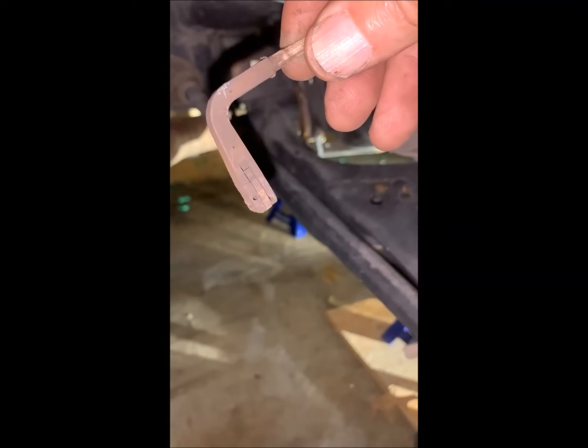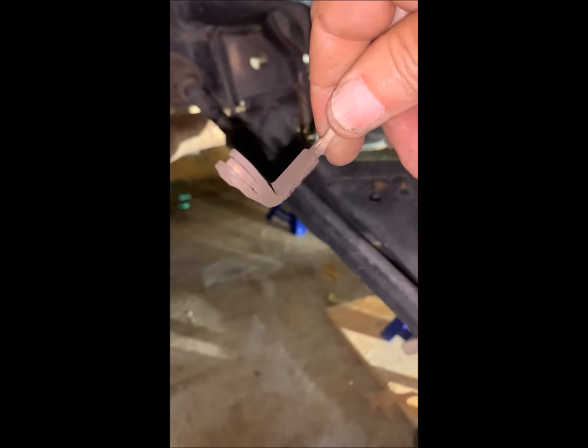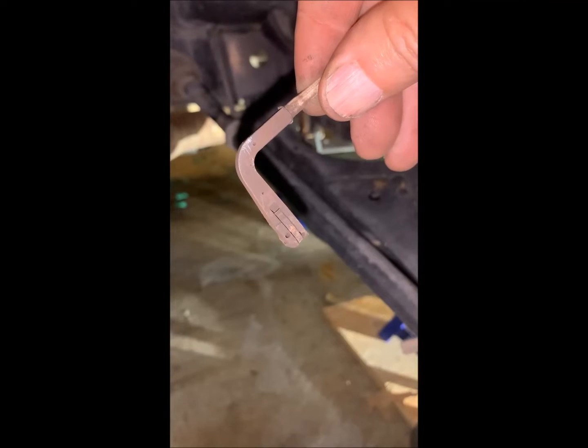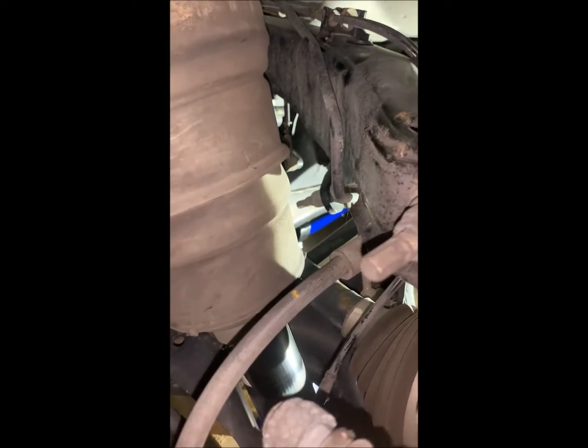Okay, so I've taken that rear brake wear sensor off, and this one's still just fine. We had some pad left, but it's getting down there. The point I want to make here is that I'm just going to tuck that down out of the way while we do the rest of the project. Do not go in and just pull this off and disconnect it from everywhere you find it, because you're never going to get it reinstalled in the right spots. This is one of those things where you have to lay the new one right next to the old one and do it one connection point at a time, because otherwise you will never get the routing right.